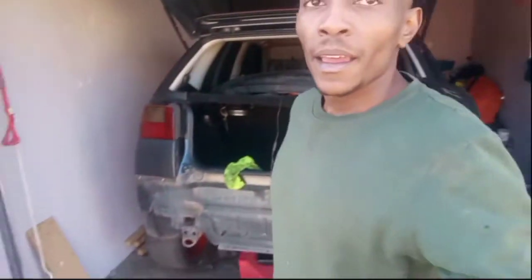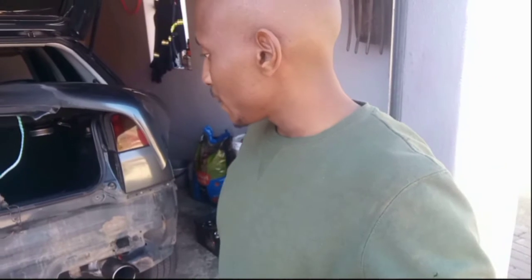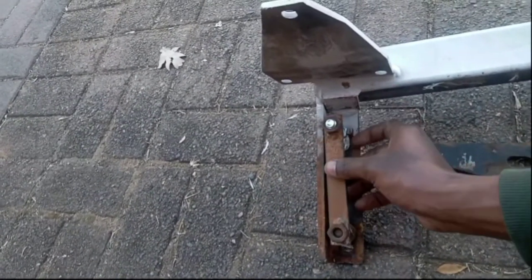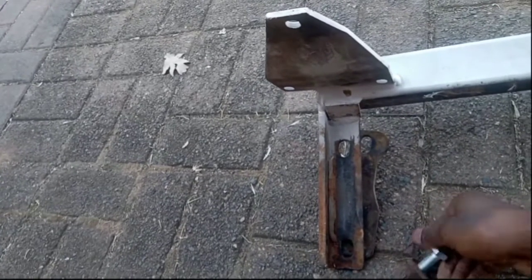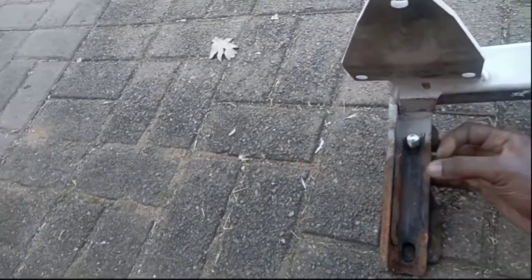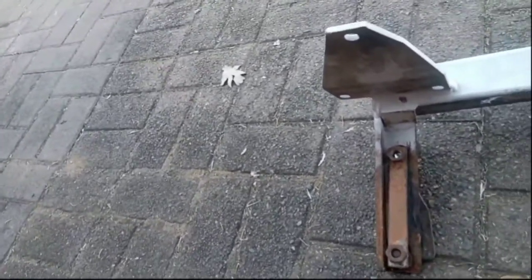So guys, one crush bar out, one tow bar in. Okay, so time is finally here to place the tow bar right on the car. Everything else looks good. So the way this is gonna work is, see this plate with the welded nuts, it's gonna be at the top, and this plate is gonna be underneath. The two bolts are gonna go through that plate from underneath the car and bolt onto this plate here to hold it in place on the car, and that should be it.